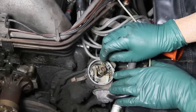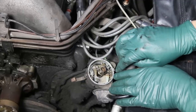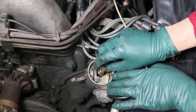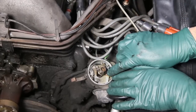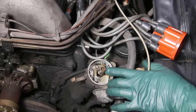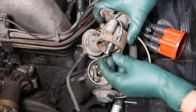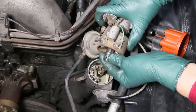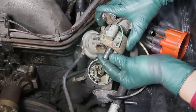That can be checked by a dwell meter. If I wanted to keep these points, I'd probably have to take this distributor out and rebuild it — get some new bushings in it. I've got other used distributors around that I could maybe find. Look at the play in this one. There is no play — absolutely no play. Those bushings should be real tight.